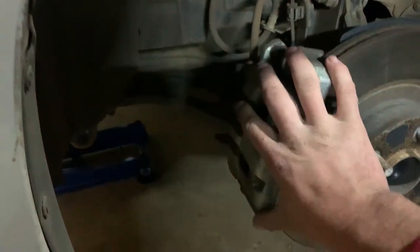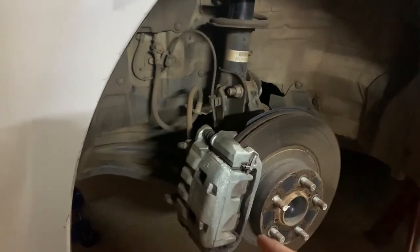What we're gonna do next - because Subaru and Toyota love this so much, mainly Subaru - is take your 14mm, locate your bottom slider at the back of the caliper, and then quickly loosen it. We'll be able to flip this caliper up like that.